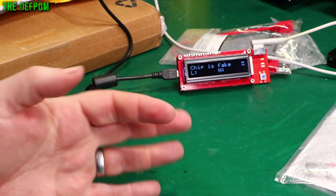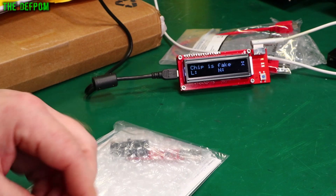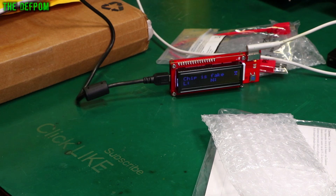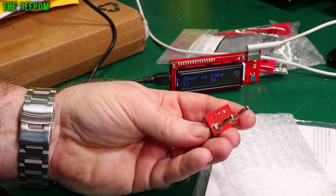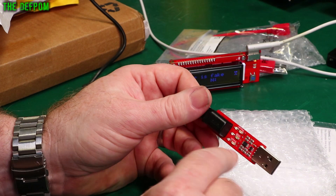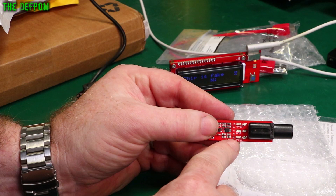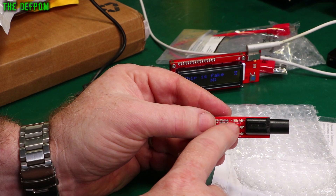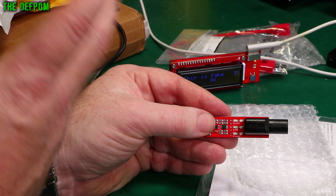Harold from Chipmunk has generously sent me an extra piece — a little USB tester. You plug it into a USB port and it has indicators which tell you the activity of the port: whether you've got power, whether you've got a true five-volt supply, or if it's under voltage like four volts. It also tells you if there's activity. You'll see Paul Daniels using this quite a bit — you plug it into the port, try to boot up, and see if there's any life from the CPU. There'll be links down below for these.